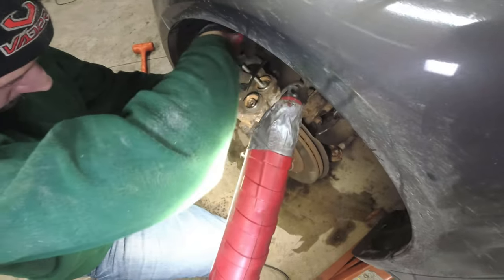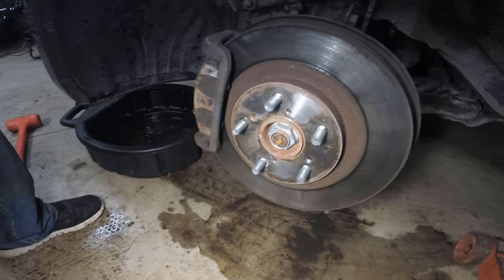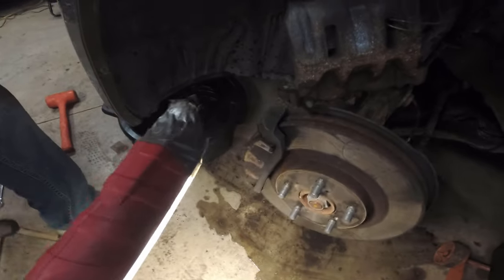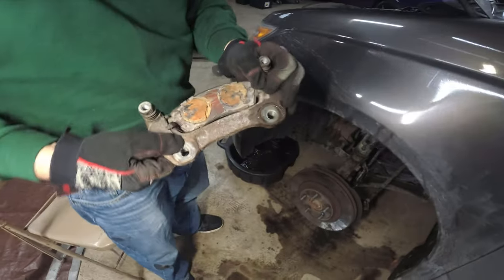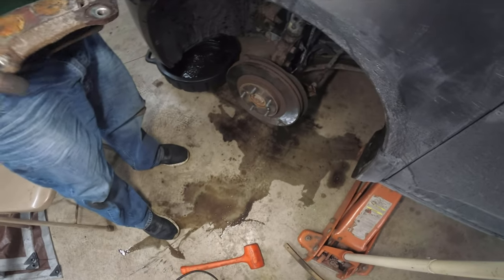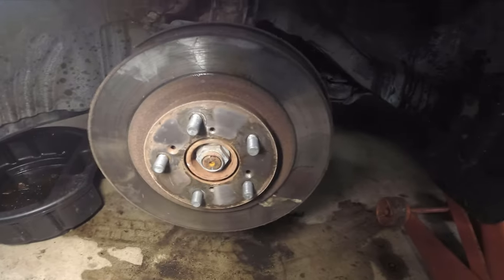With the caliper hanging from the coat hanger, if this is the first time the brakes are being done on the vehicle there's usually a screw holding the rotor in place — we don't put that back in because it can strip and that's a whole other video. Use the 19 millimeter wrench to remove the caliper mounting bracket and brake pads, using a rubber mallet to strike the wrench and break it free. Take that bracket to the bench to clean it up. Our rotor is loose; if it's not, start hitting it with a hammer. These rotors also have a screw hole where you can drive M8 1.25 bolts in to push the rotor off from the spindle.